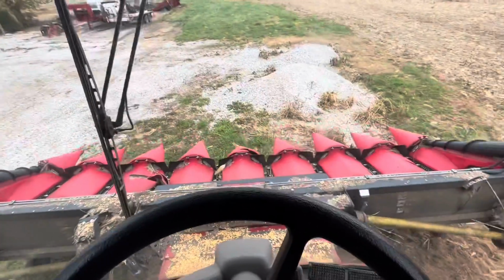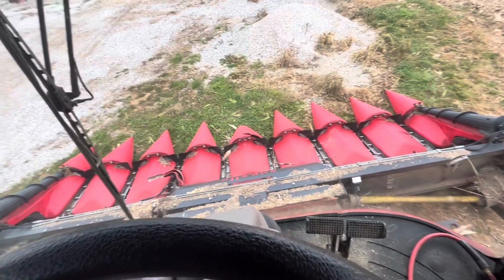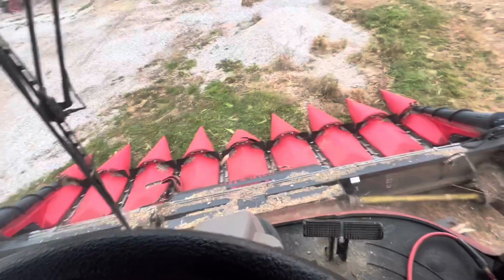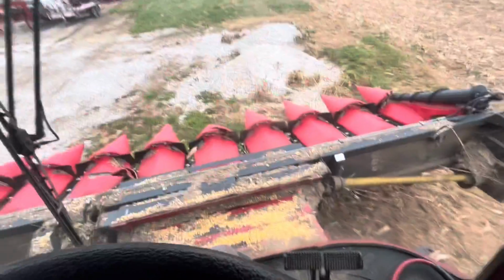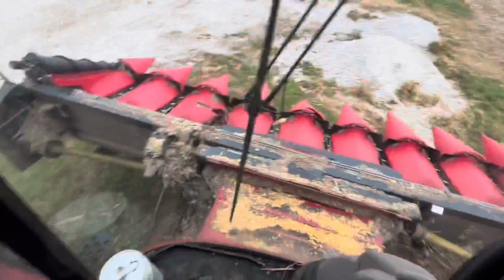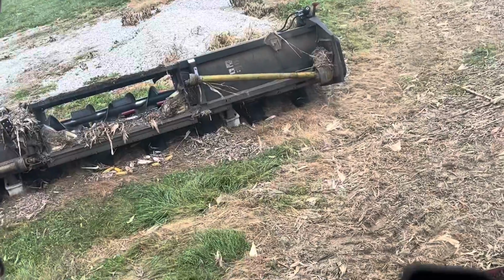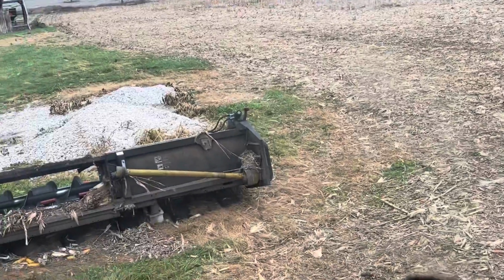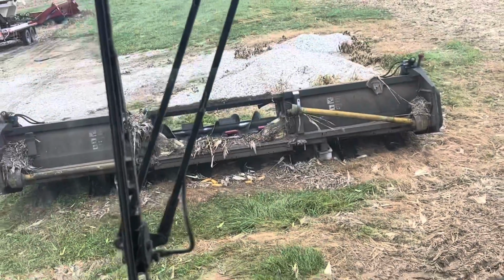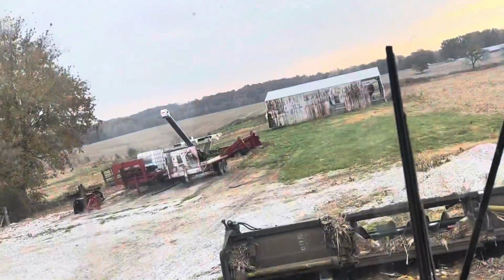Well, we're done with this one for a while. All unhooked, setting it down. Actually, we're gonna pick it back up because I forgot to put blocks under it. I need to do that. So we're gonna put blocks under it, and then we're gonna set it down. Intermission. Unhooked. So the reason I put it on blocks is because I didn't want my stock stompers. They've got springs in there, and I didn't want them basically getting stretched, so lifted it up with some cinder blocks.